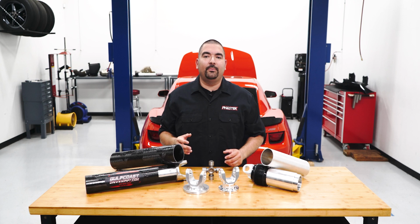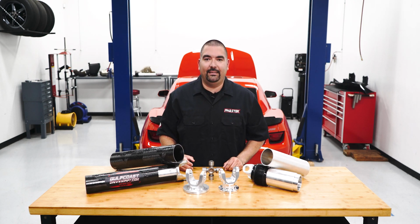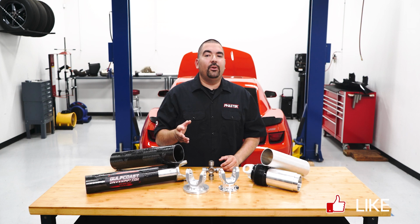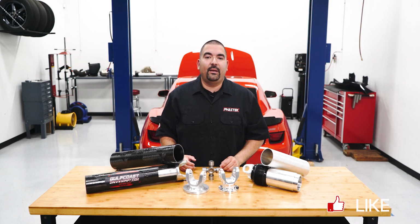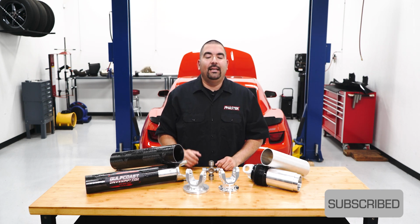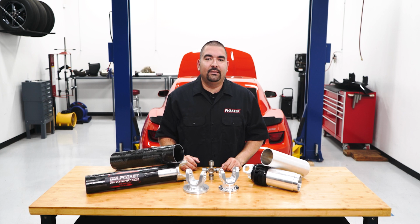When adding power to your Camaro, there are plenty of things that will need to be upgraded to handle the amount of power you're about to throw at it. One thing that seems to be not thought of when replacing some of these parts is the drive shaft. Now, although the factory drive shaft can hold a decent amount of power, the actual drive shaft is typically not the issue. It's the center carrier bearing that tends to go out before anything else.